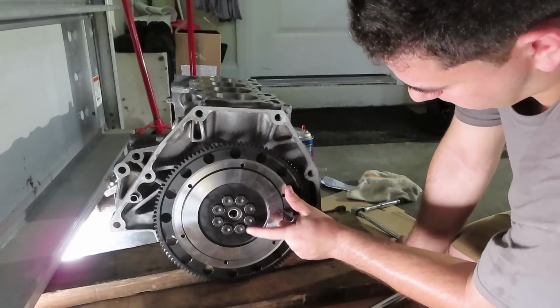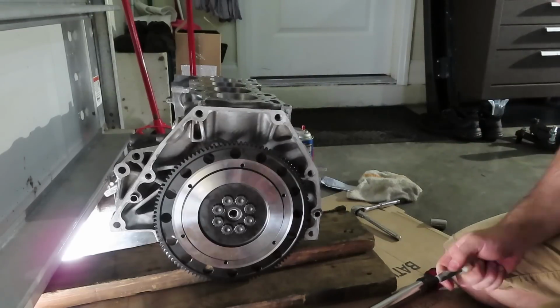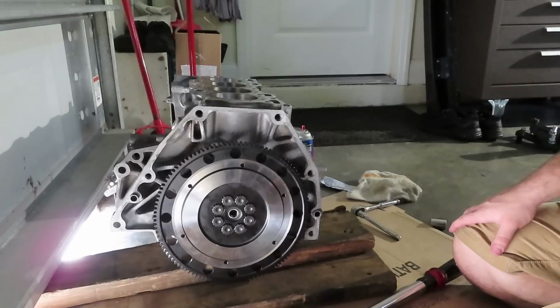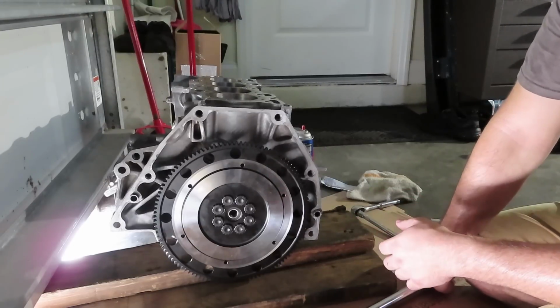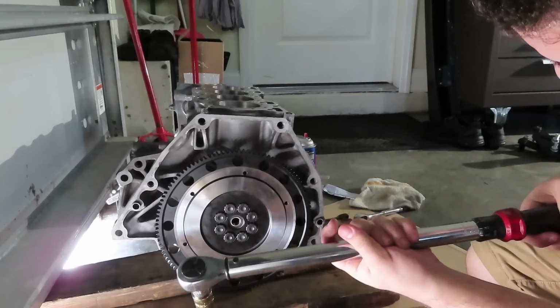You can just take it off, and for the final step, I'll just do 1 dot. I typically don't do this because I don't often forget. I usually keep an eye on them, but it's just a little tip. It helps out some people when they're doing torque sequences like that. So now we did 30, 60. The next step would be 90 foot-pounds. All right, guys, nice and simple. On to step 3, 90 foot-pounds.